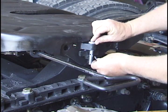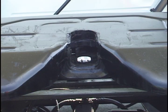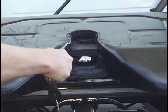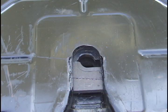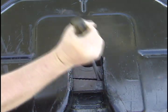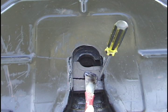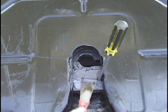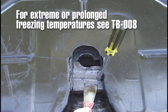Now reinstall the top plate and lubricate the lock mechanism. First, trip the wheel closed by pushing the bumper off its seat with a pry bar — be careful, when the mechanism closes the handle moves in quickly. Next, pull back slightly on the pull handle, separate the jaw and wedge with a big screwdriver, and distribute grease between the jaw and wedge, pressing it between the serrated surfaces. Fontaine recommends a MOLY-based lubricant such as Mobil Grease MOLY 50 or equivalent.